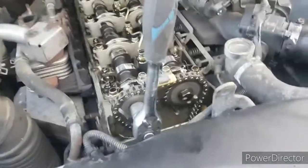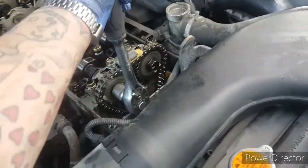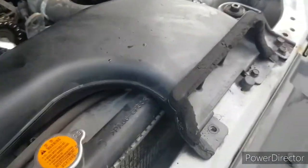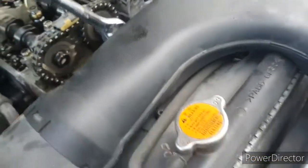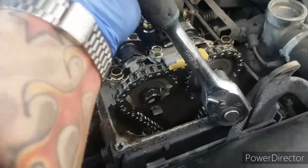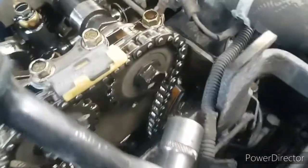I was going to give the ignition key a quick flick to reset the tensioner that I just fitted, but I reckon I could turn it by hand with a 19mm socket - let's have a go. Try this side. Oh yeah, that did it - I heard it click. I only had to move it a tiny tiny little bit and it obviously hit that catch. I don't know if you guys heard it or not but I heard the tensioner ratcheting.